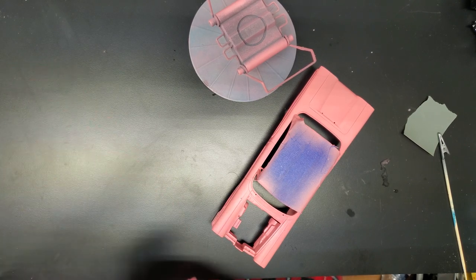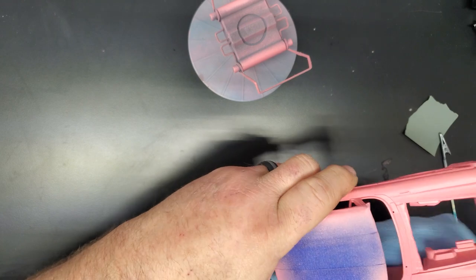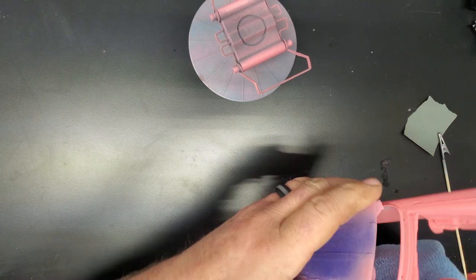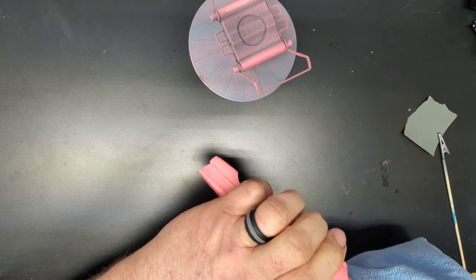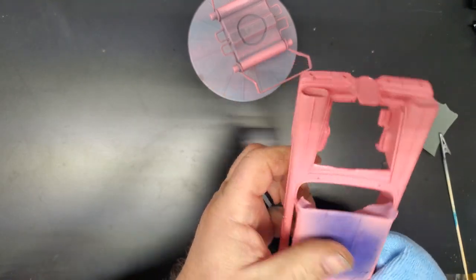Okay, wipe this dash down and we should be good to go. So I always gotta be careful. I have a golden doodle in the house that every time I go in the house, she wants to give me a hug. And they don't normally shed, but every once in a while she'll get a hair. I notice if you have hair and stuff on your clothes, sometimes that paint booth can suck them into the paint. You just pull it right in. You really don't notice it until it's too late.